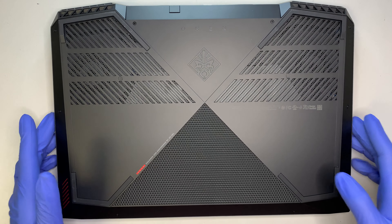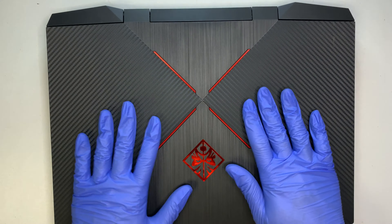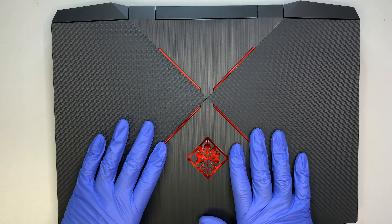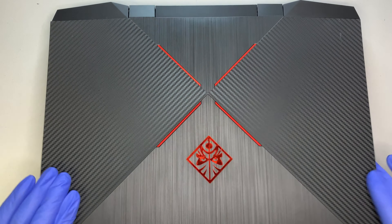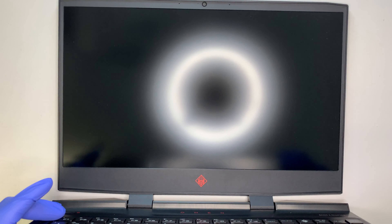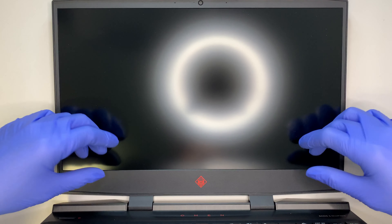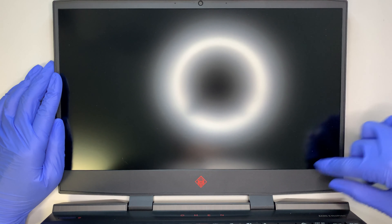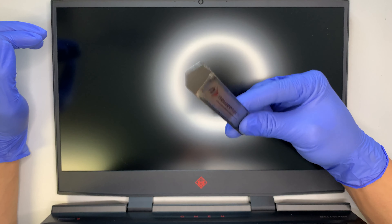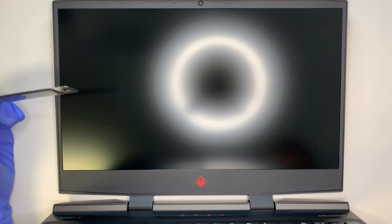So I'll be doing a screen replacement and I'll give you a step-by-step tutorial on how to do that. Let me turn it around and show you how it looks — this is the front of it. Alright, hopefully you have the same model as I do and let's get started. At this point, it doesn't have any screws on the bezel, so you don't need a screwdriver to remove the bezel. It looks like it's double-sided tape all around the screen, so what you need is a metal or plastic prying tool.